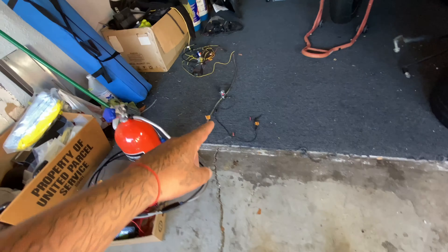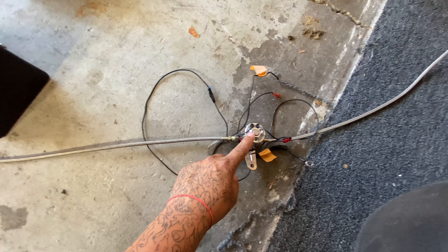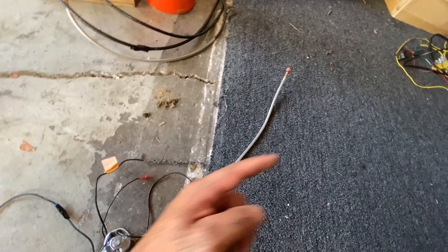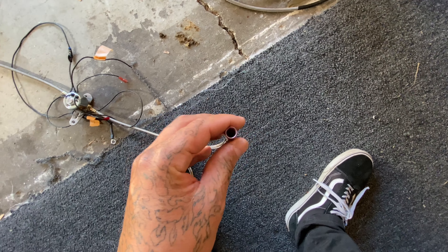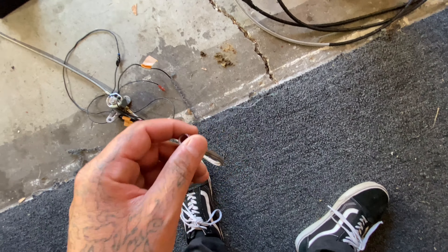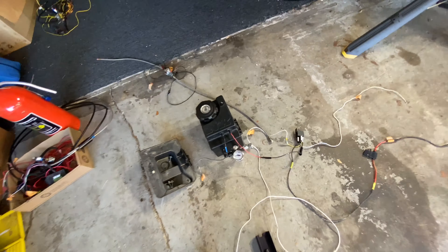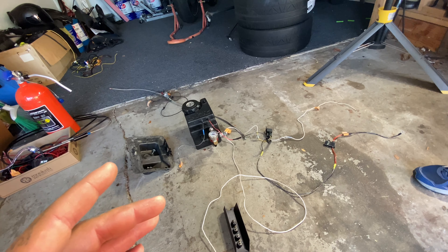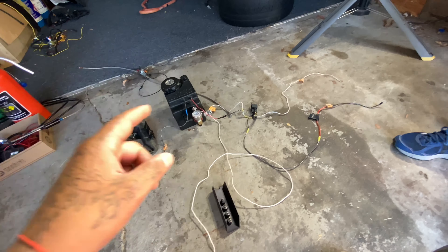From here the fuel line went out, and from this fuel line it went straight to the fuel solenoid. Here it is — this is the line where it connected. Once it engages, the window switch tells it to shoot nitrous; it shoots into the throttle plate — the coyote plate — in here. The coyote plate does its job, mixes in the nitrous and fuel, and then you go pretty fast.